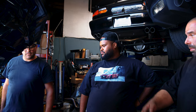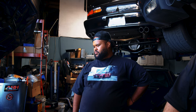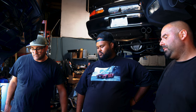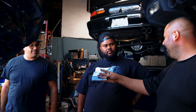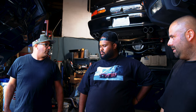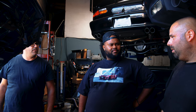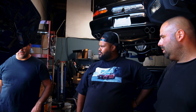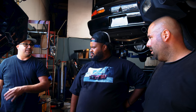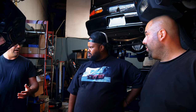Do you want to do Flex Fuel on this one? Yeah, I'm going to pin it, pin 56. I won't disconnect the computer right now, I'll just let you do your thing. You have a two-bar on it? Nope. This is exactly why we need to coordinate. I assume it's probably running off the MAF right now. It is. So you don't need a two-bar. So I could put it on MAF still, but when we put it on the dyno, get the two-bar in there. I'd probably put the 80 pound injectors in with the data for them, so you can start the car and run it on the existing tune. Because if we go speed density, I need a little bit of drive time to at least see how things look. So let me run it off the MAF — that's easier to tune for just a base flash. So no E85 yet. I'll pin it all.